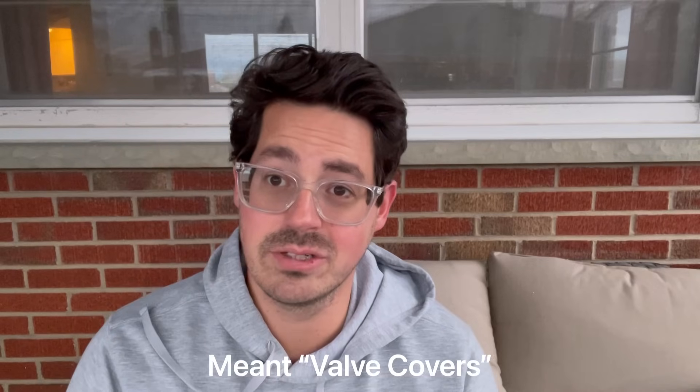I was a bit befuddled until I decided the only thing that's left here is that maybe some of my valves aren't moving up and down like they should. So I took one of the rocker arm covers off, started the car, and sure enough, I saw that probably half of the valves were activating correctly, and some of them were moving only slightly as the car was idling. I thought, uh-oh, that's probably a bad camshaft. And it was — with 25,000 miles on it.